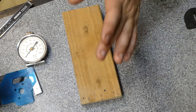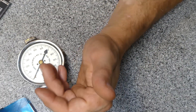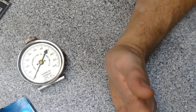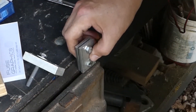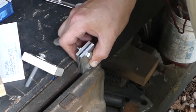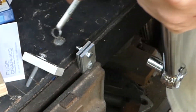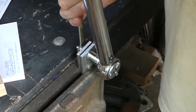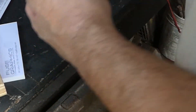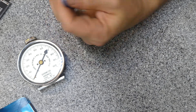As far as real-world performance, that's where torque comes down to. Measuring performance in the real world is much more difficult other than throwing it on a machine, which I'm already doing. A good test — and I had a lot of comments about this — would be to put the gasket under compression and then heat it, and I did do that. I used two pieces of aluminum and squeezed the gasket between them at a known torque setting, heated that up, and checked if it could hold that torque setting. I didn't use an extremely high torque because at some point this stuff is just going to start squeezing out. My purpose is to see if it will hold its seal for things like carburetor intakes or maybe even a valve cover.